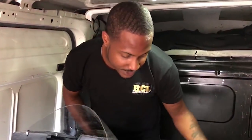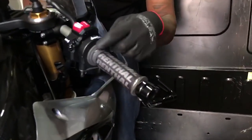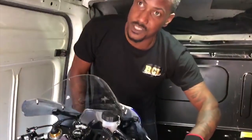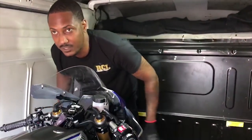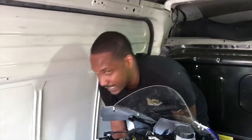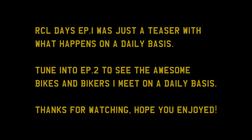The majority of bikes get strapped by the handlebars, but if you look at that one, those are handlebar protectors, and these are soft race special grips. So I avoid touching them because it's probably got a quick action throttle and it's very technical. So what I've done, I've strapped it to the forks instead. So it's still the same stability. It's a little bit harder to strap up, a bit more work, but prevents any damage of any sort. So yeah, that's it.